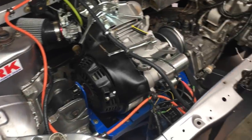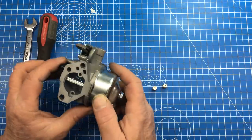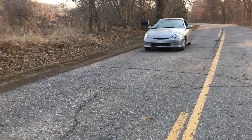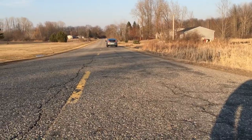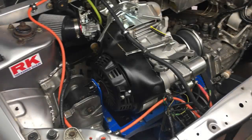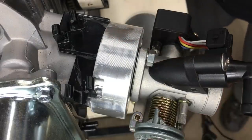Here's the little 420cc Hemi that got the car up to 64 miles per hour on a straight and level road, which is pretty impressive because the engine is more or less stock. We did upsize the carburetor jet due to the less restrictive exhaust. While the high speed performance is pretty good, we still need to go a little bit faster, and it would be nice to improve our 0-30 times. Currently the car takes 11 seconds to accelerate to 30 miles per hour, or 48 kph — that's way too slow. We're about to take this very reliable 420 Hemi to the next level with the cheapest EFI kit on eBay. We've bench tested the kit and built all the sub-assemblies, so it's time we go ahead and get her done.